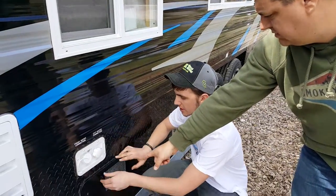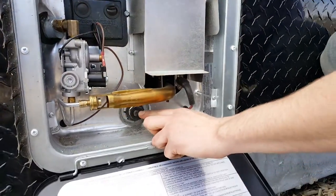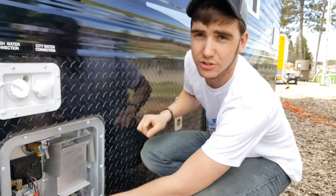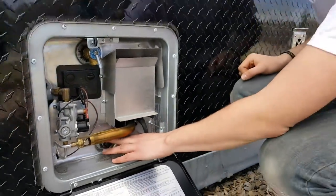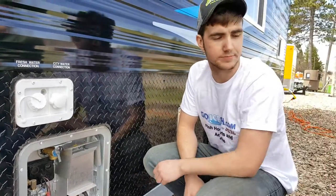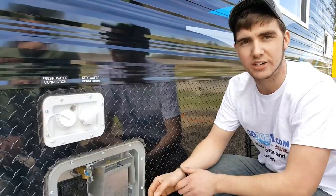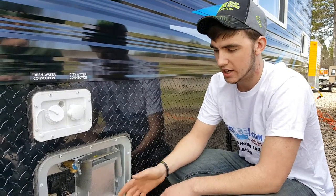Underneath is the hot water heater. It might look scary but there's not too much to worry about in here. Down on the bottom you can see the anode plug, which should be replaced about once every two years. This is also used in winterizing the Ice Castle — pull this out in the fall, let the water drain out of the hot water heater, and leave the anode plug out for the fall, then put it back in the spring. You can run antifreeze through it, but you'll always get that antifreeze taste. So we shut the water heater down from the inside, drain it from the outside, leave the plug out in case there are any remnants of water, and then shut it off from inside the house when we put antifreeze in the system.